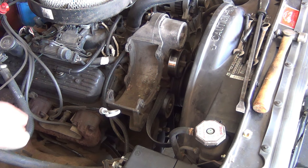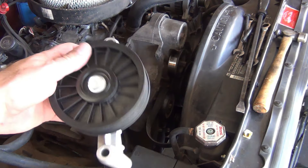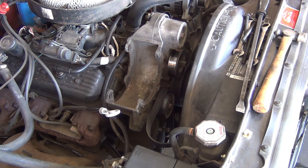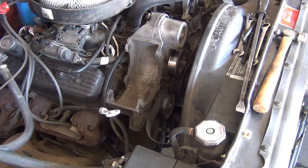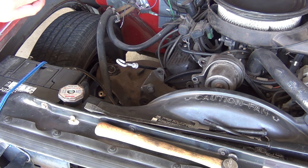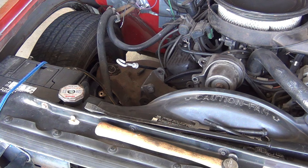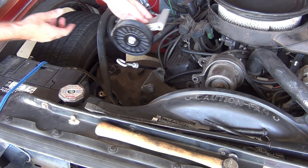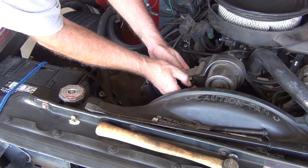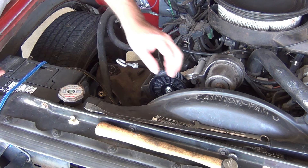So that's what we're dealing with. Now we've got that filthy compressor out of there. Now we can put in our new air conditioning delete bracket, which is basically just going to fit here like this, where those bolts were, and that's going to hold our pulley. From what I can see on this thing there's no right side up or right side down. I'm going to put it so you don't see the 'made in China' stamp, put that on the bottom like that - that also puts the part number up top. Get one of our bolts and stick it in there, and another one. That's basically all there is to it.